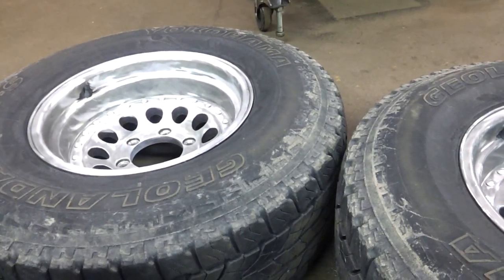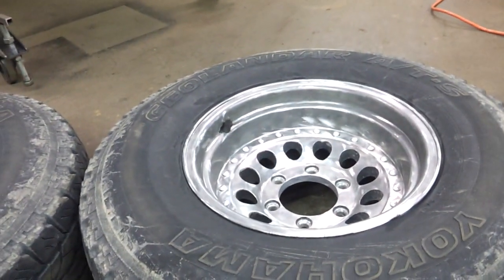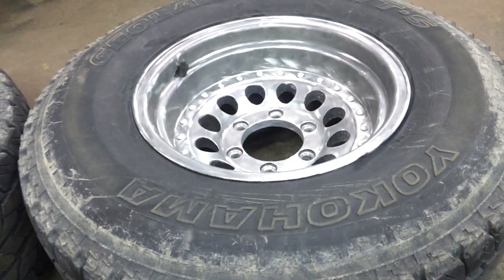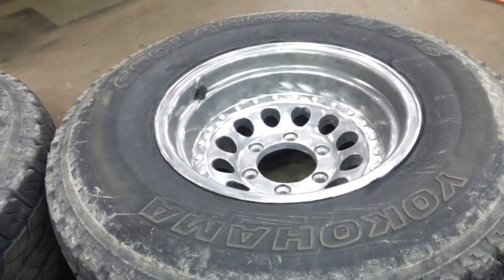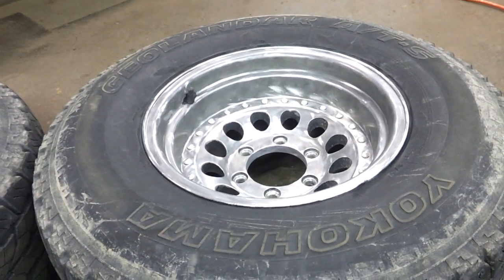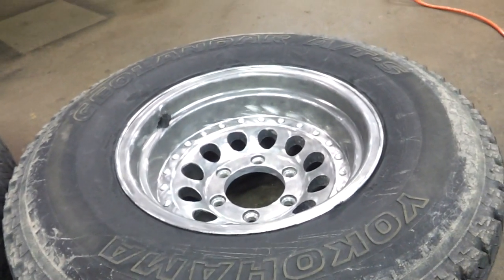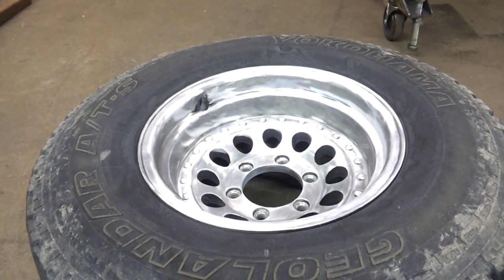As far as the outside surface, it's all shiny now. The reason why I felt it was important to take it all the way down to the metal — instead of just roughing it up like I'm going to do in those holes or around the valve stems — is because you're going to see the transition between the different layers of paint. Down in the holes or around the valve stem it's not as crucial and not going to be as noticeable, whereas everywhere else it will be. So that's why I did it, and they're shining like all hell right now, which is kind of cool.